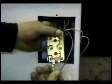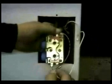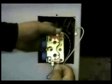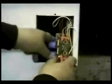Install the wires on the solenoids, the blue one on the bottom solenoid with a white wire, the white wire on the top solenoid, and then the orange wire. Install the holding plate, then install the water mixing valve assembly into the machine and secure it with the holding screw.